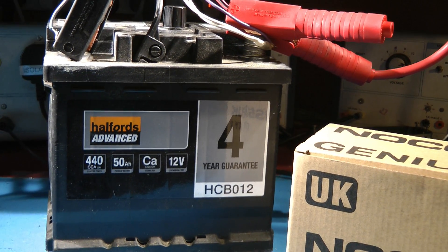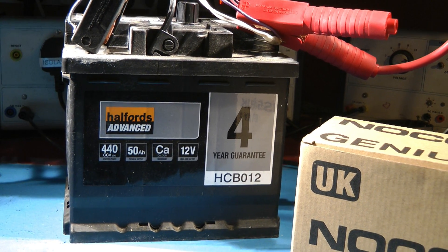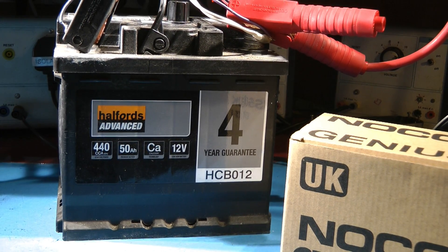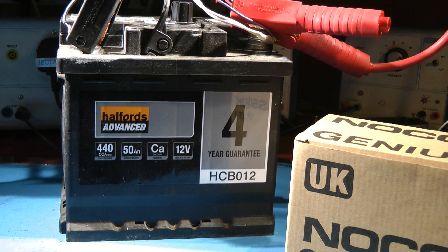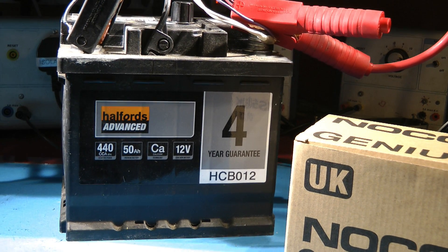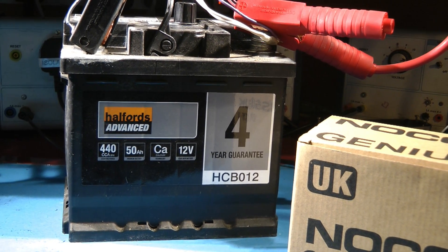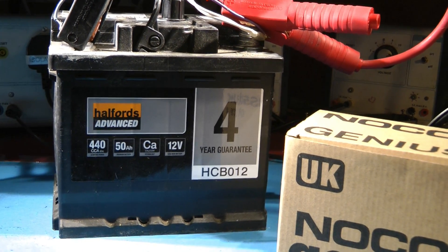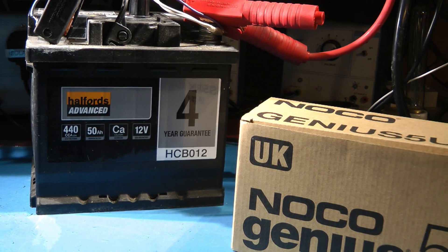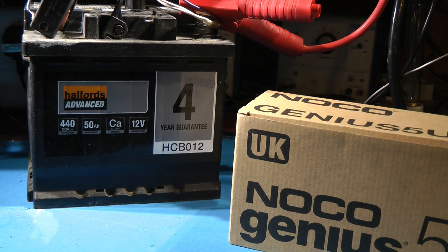This one has a four-year guarantee; it is three years old. It came off a family car two days ago. What was happening was that it was starting and running fine, but if you parked it and, say, cleaned the car with the doors open, within an hour the battery would go flat. The cranking amps were sufficient to get the car going — in fact it seemed quite sprightly — but there was no capacity there. If you left the lights on 15–20 minutes and came back, it was flat.